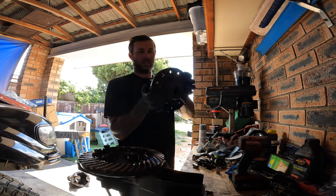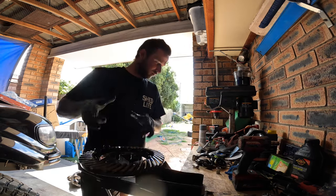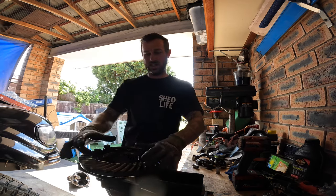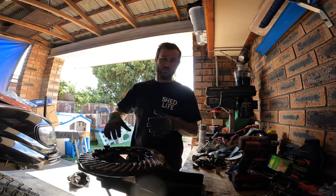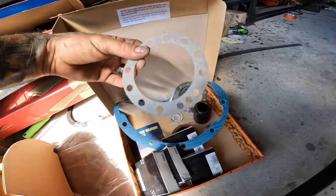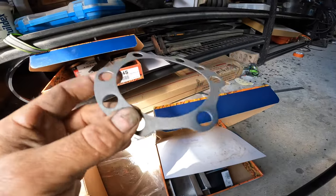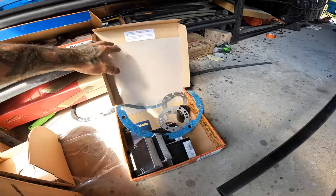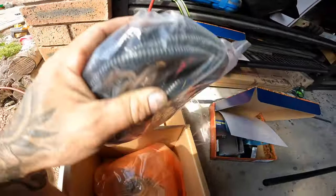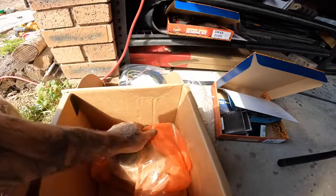So that's the existing diff center back together. We'll move that out of the way and go open our new diff center — our locked one. I just had to work out what was the front and what was the rear diff rebuild kit. This is my rear because it's a circle gasket skirt, and that is the front because it's the same shape as the front hub covers. So we're unboxing the rear locker — there's my wiring, stickers, switches and whatnot, a couple zip ties, and that's your diff center.